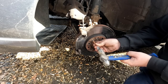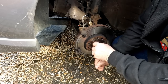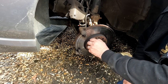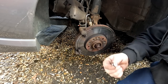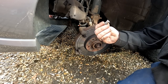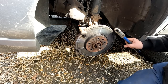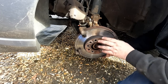I can see me having to drill it out. Oh, I've got it — one last attempt and I've got it. Before I do anything else, let's just take that out. I really should put a new one in there, but what I'm going to do is put a slot in it. A lot of cars don't have them fitted, so it wouldn't be disastrous if I didn't put one back in. But because there is one there, I obviously will. That was terrible — that was just on the verge of me drilling that out. So the next thing is you can't actually get them out with the carrier on — you've got to take the carrier off as well.